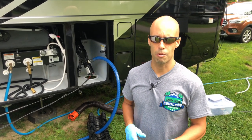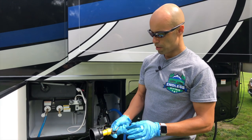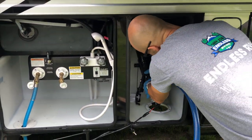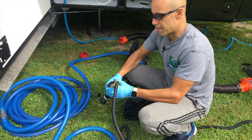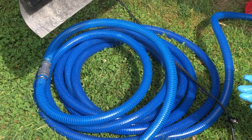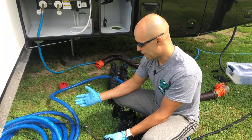Guys, we're back — black and gray have both been dumped. Last thing to do: I have a sewer hose rinse hooked up to my black hose, already pressurized with water. Make sure your black and gray valves are both closed, then unhook it and cap it into the inlet here. Turn the macerator on, turn the water on, and let it run through for a couple of seconds until you're seeing clear. This is just flushing out anything the macerator might not have chopped up — toilet paper, any other hard particles.